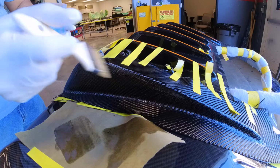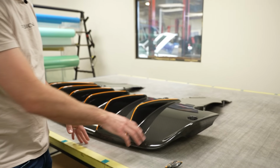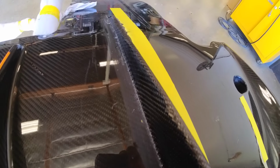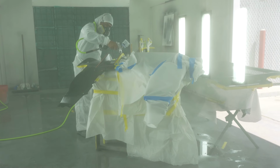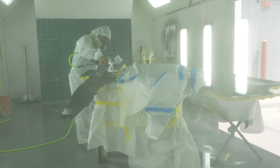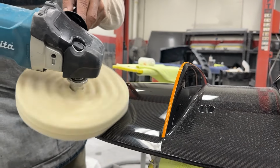put the resin on top, and then there's multiple steps to doing a finishing. So at that point, they have resin on top of carbon fiber. They'll put top coat and then clear coat after that. So there's lots of sanding steps in the way, tons of labor.